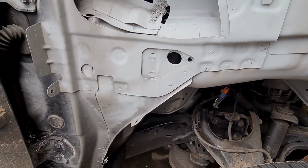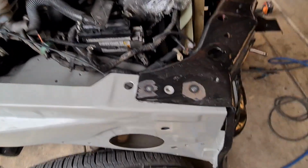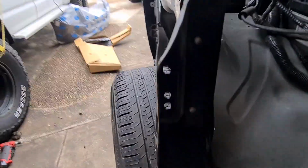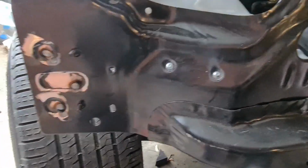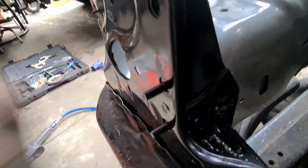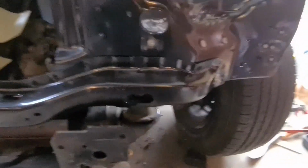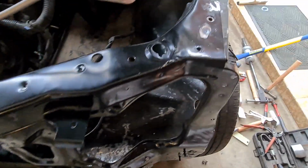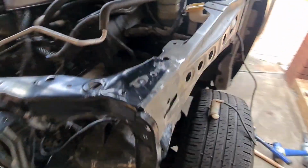Alrighty, we're all welded back up, spotted up, looking good. That's what you get out of the pinch welder. You can only do them where the pinch welder can reach it. And then these ones here are just done with the MIG. You can't get up inside the framework there to get it. Same as down in there. Same on this side. Run across the front here. Go to there. That's with the pinch welder. But all back together. See it out lining up pretty good.